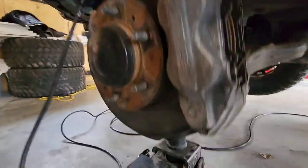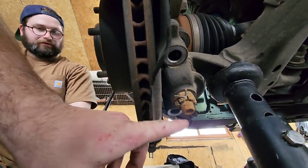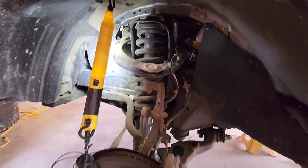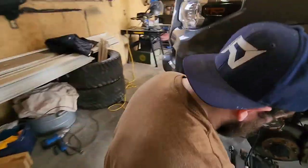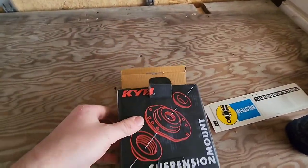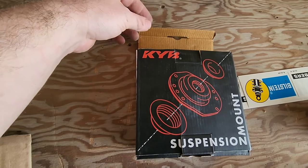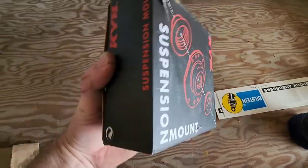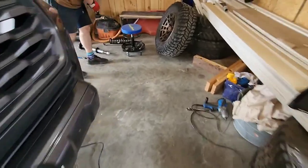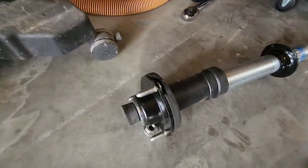So in the back — let me give you a quick run-through. We start off by taking off two bolts — there's one on each side beside the castle nut — and he already has his top hat bolts off. He's not reusing any of his OEM hardware. Let me grab the box for the top hats. Here's the top hat he's using with his Bilstein struts, and he's already got them mounted on the Bilstein. We're going to reuse the stock nuts.